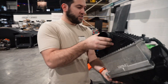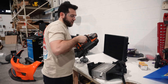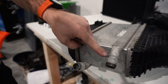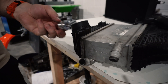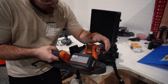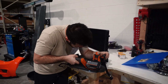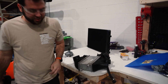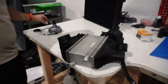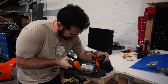All right, now let's get to cutting. Safety first! I'm going to aim for the middle of the quick connect fittings so that when Sean welds, he can use the lip that was formed in to back the weld — giving him a nice weld surface instead of just the thin poopy end. This should just really eat right through it. Boom — it even fell right into place. Sean might actually be impressed with us for once.